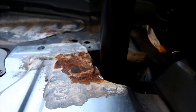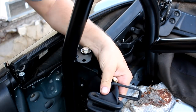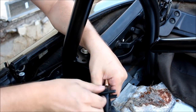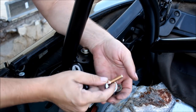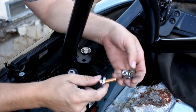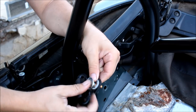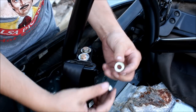There's our cutout — perfect amount of clearance for the bar, and this can be bolted back in. Now you've got to attach the seat belts. Take this rectangular trim piece that goes around the belt and remove it — it won't serve its purpose anymore. Take your bolt, put on the large washer, standard washer, and little spacer, then it goes through the belt into the tower, then a washer and nut on the bottom.